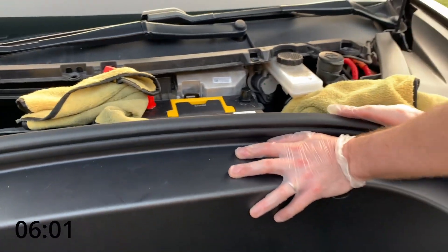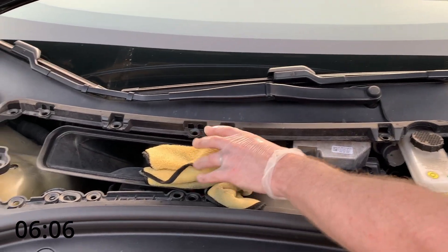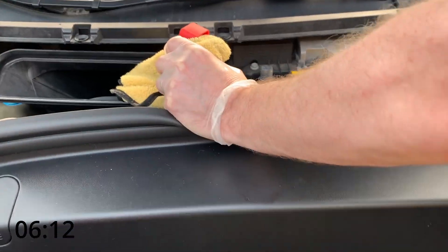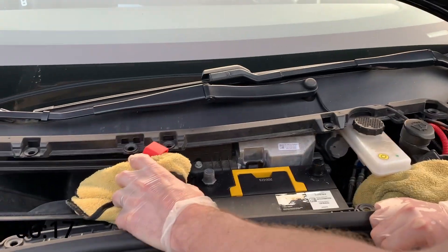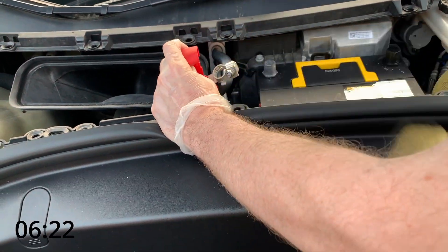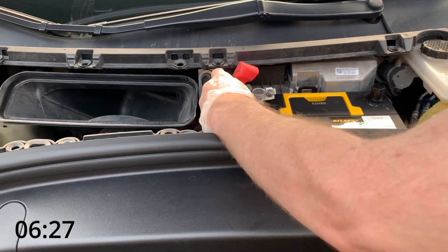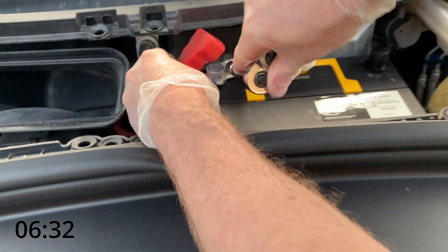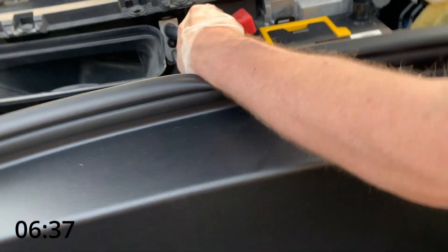There we go — slide the new battery in place. Next, carefully move the positive terminal over. There's a cap on the new battery — take that off. There's a cap on the positive and the negative; we'll do one at a time just to be safe. Take the towel off very gently, expose the connector, place the connector onto the battery, and tighten it down nice and tight. Then cover it up.